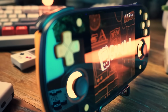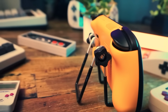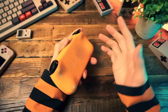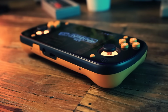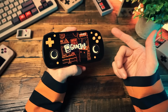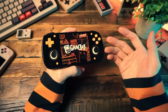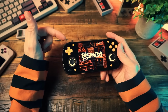As your battery degrades over time, your device still tries to measure how much juice it has using an internal meter, a baseline voltage reference, which is stored in the battery controller on your device. And that is called calibration. But as the battery ages, the voltage reference gets out of whack. The device thinks it knows how full the battery is, but it's wrong. That's when weird stuff happens, like it says 30% and then 5 minutes later you're staring at a black screen and crying. Or maybe it stops charging properly because the system doesn't understand the battery's true capacity anymore.